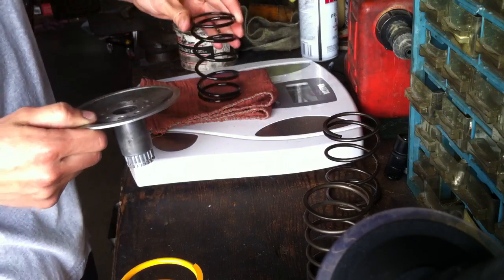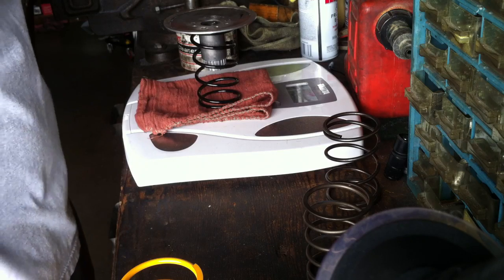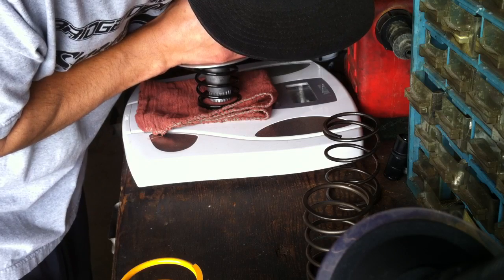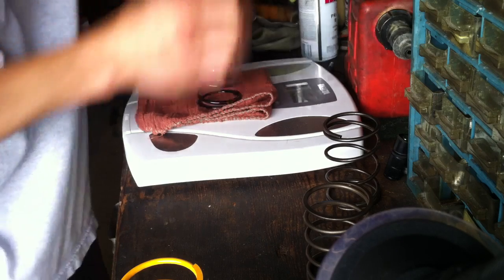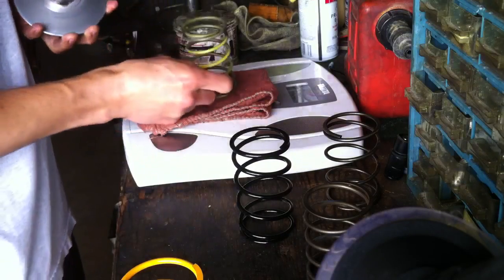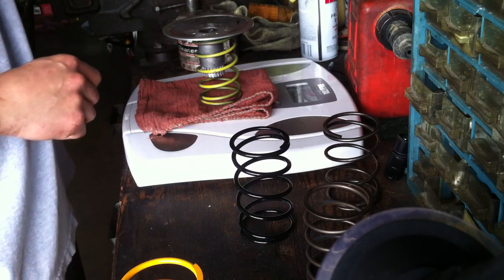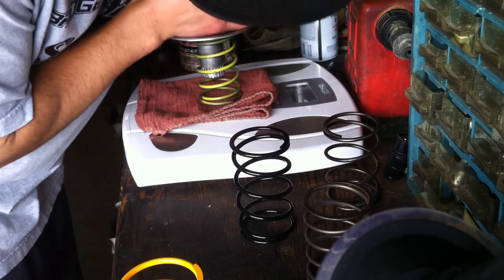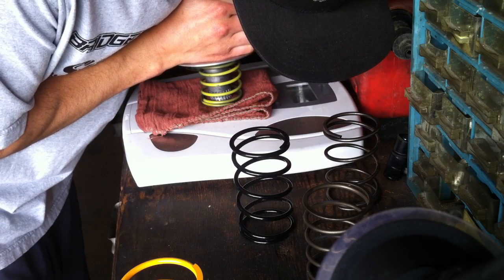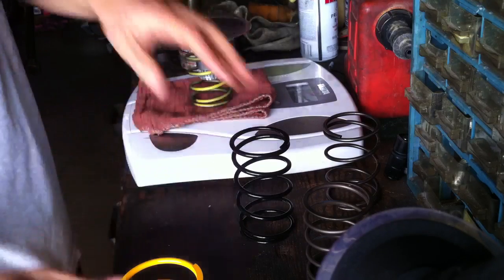This is a black 1500, so I zero it out and push down. This one's 59.2 — that's the yellow Contra from Battlescooter, which is the one that doesn't fit the Ruckus. The other one is 42.6. That's how I measure all my contra springs.